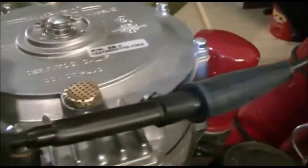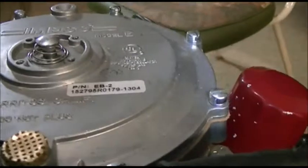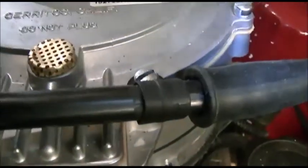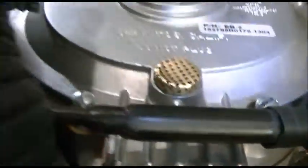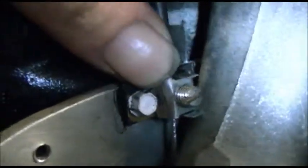Here's my cable system. Single cable into a double — the double's right here, just behind the vacuum vapor hose. That's where it changes. I've got it clamped on here. So one goes to the throttle and the other one comes down to my oil metering pump. I've got the end of it clamped with a nice little clamp there that should never come loose.